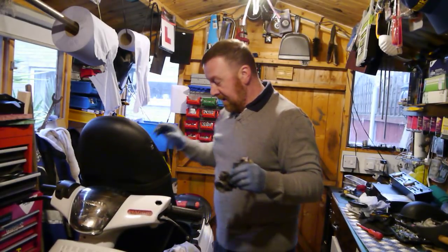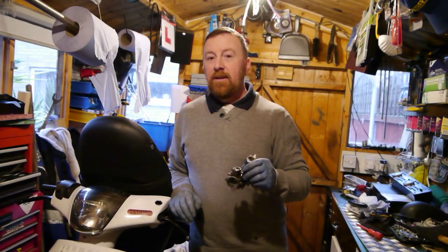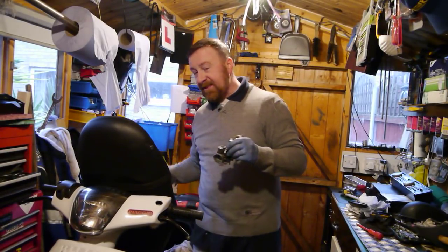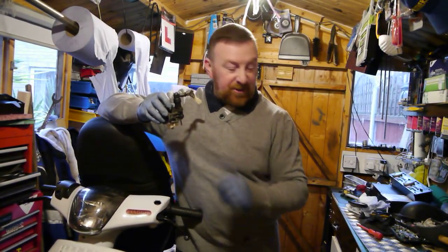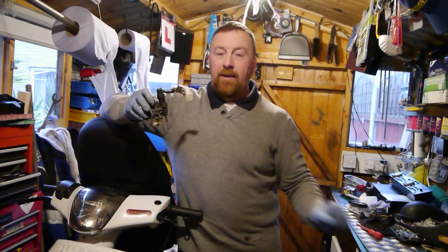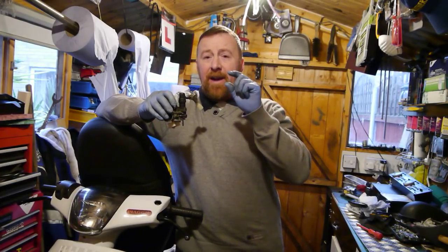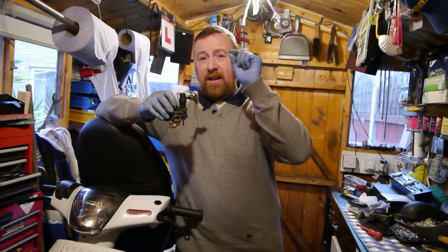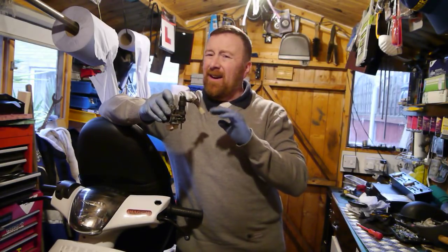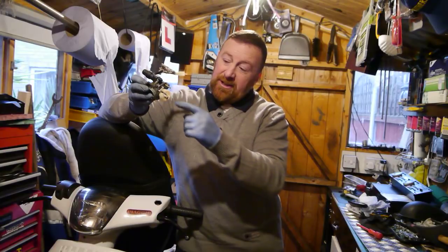This needs to be started and slowly accelerated at the same time. A lot of bikes are like that — and the Speedfight, kickstarting this time of year, lovely. The moment you try and let it start on its own, it's flooded. So it's getting used to them. I checked the jets — fine. The other one had a sports exhaust; this one is standard. So I'm going to go down from a 68 jet to a 62.5 — still bigger than stock, but a lot less. That should sort out the flooding problem. There's another thing you can do, which I haven't spoken about much, and that's the needle. Around the needle there are three little lines and you can reclip them. Lower means more fuel, higher means less. You can move that around — but that's another video and it's a bit complicated. You can lose the pin — world of pain.